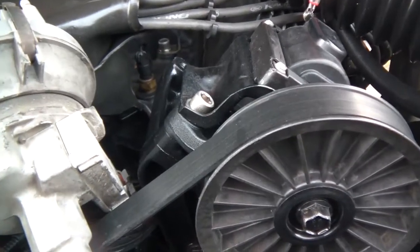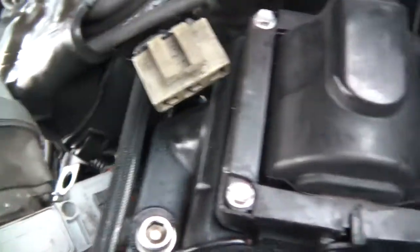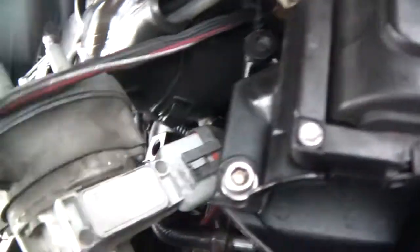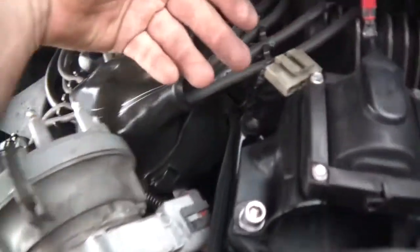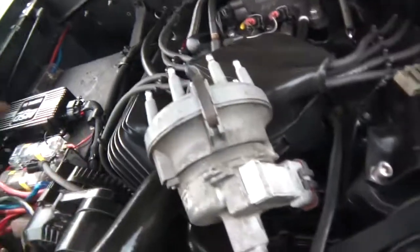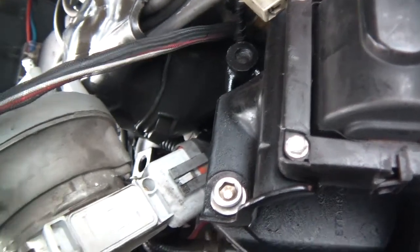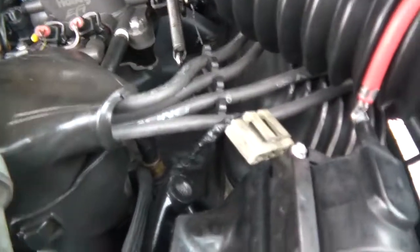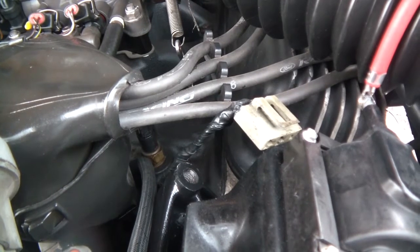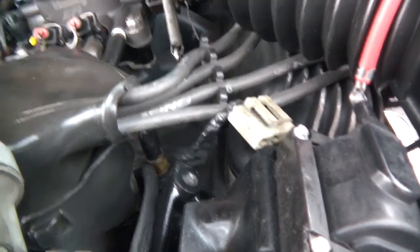Now I'm just going to hook up the MSD box. I'll just unplug this wire and plug in the wires there. I'm going to take the existing TFI power plug, plug into this side of the module, and then plug in this side of the TFI coil. So in the event of a failure, all I have to do is unplug these two, plug the connector back into the coil, and I'm back on the stock coil — bypassing the MSD totally, 100%. This doesn't control timing or anything, it just controls spark. Timing is all done from the computer. The cool thing about TFI is if you lose sync with the computer, it's going to at least be back at 10 degrees before top dead center. TFI is pretty cool — pretty basic setup.